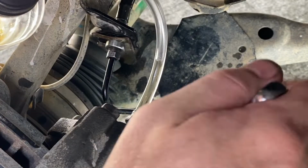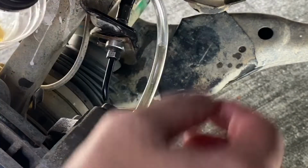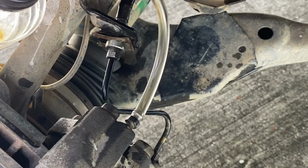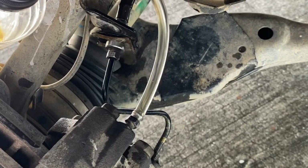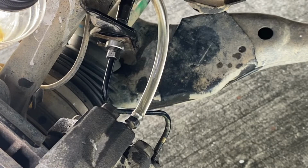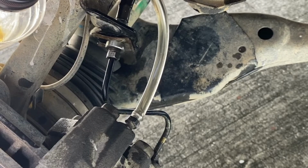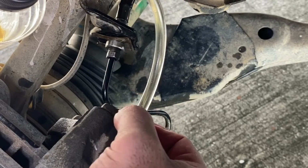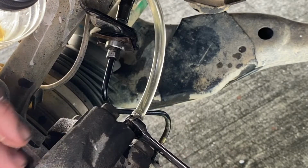There's some air right there. A little bit more dirty fluid. Like that. Hose is where it's supposed to be. It's still in the water. Awesome. All right. Couple of pumps in between this too, so you know I did fill the reservoir. So we're going to give this a couple of pumps here. Nice and smooth all the way down. I saw the air bubbles coming out of there. Let's lock it up.